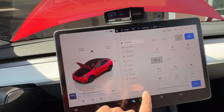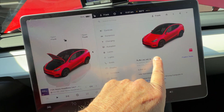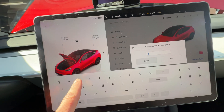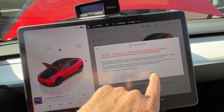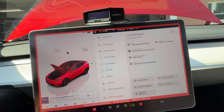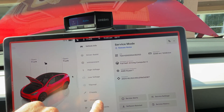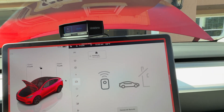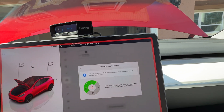I'm going to hit the touchscreen, come to Software, hit and hold the Model Y, and when I release it it's going to say 'enter access code.' The access code is 'service' - S-E-R-V-I-C-E - and 'proper use of service, enter.' Now we're in service mode. Once I'm in here I'm going to come over to this side and press Low Voltage, HomeLink, HomeLink Retrofit. The screen will boot up, so run. Hold the right turn signal in the active position and press down on the brake.